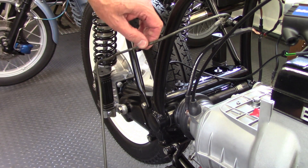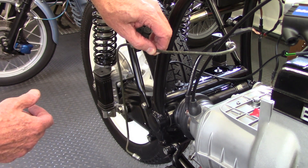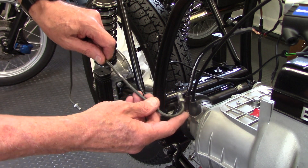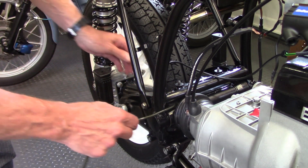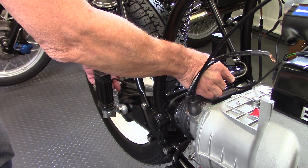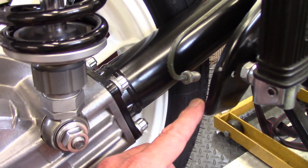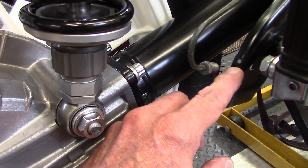The first thing to do is install the steel brake line that goes between the master cylinder and a bracket on the left side where the hose to the brake caliper connects. One end has a J and it slides in, then rotates and rolls 90 degrees to lay in right about where it needs to be because the bracket's going to be over here. This is the J end and this is the muffler bracket, and that's about where the master cylinder is going to go — that's the little hole the return spring is going to catch into.